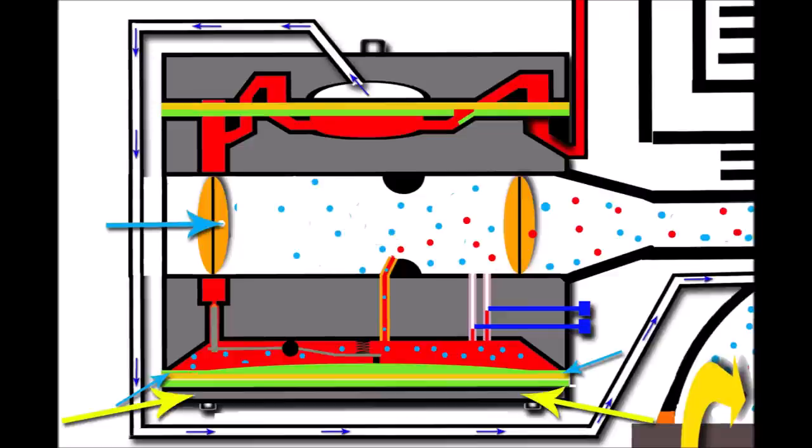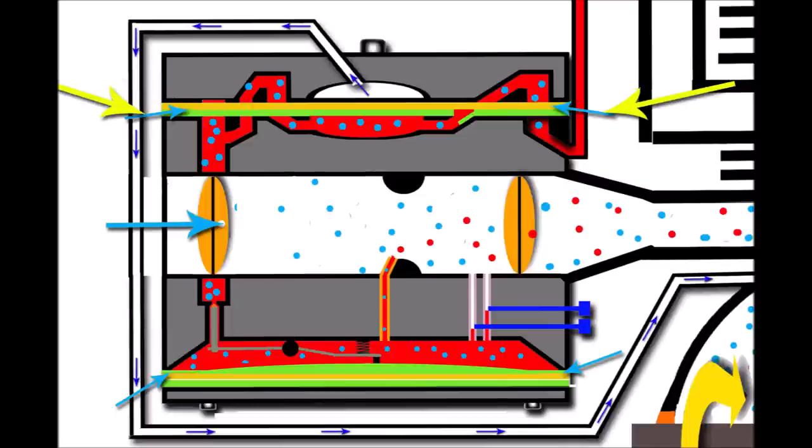The problem is the cap is loose at the bottom, allowing air in — that's what's causing all of this. The only remedy is to tighten the cap or replace the diaphragm or gasket. A similar situation applies to the fuel pump cap: if the retaining screw at the top of the cap is slightly loose or the seal between the cap and carb body is degraded, we'll get air leakage into the carburetor. That air mixes with the fuel and because of the air in the system, there's less vacuum so the fuel pump won't have the same pumping efficiency — it won't move up and down properly.